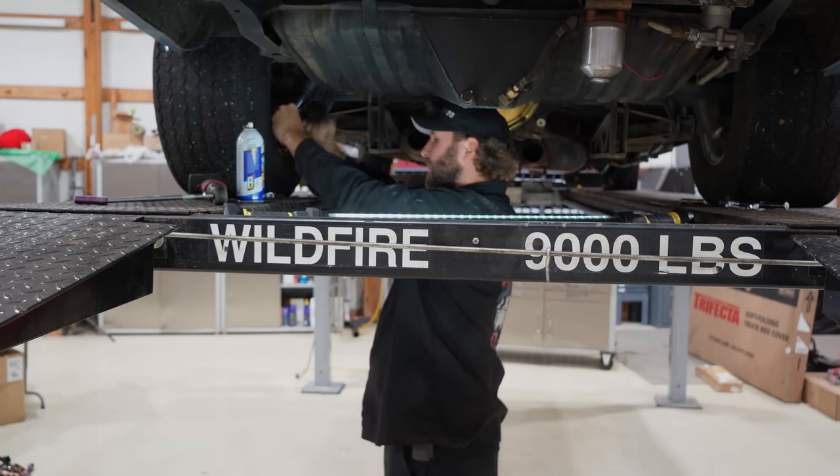Here we go again. 5,200 RPM-ish? That one's about 5,300. Yep, 230 horsepower, 294 foot-pounds. 230 horse, 294. It's pretty good. It's looking pretty flat on the graph. Were you full throttle, or three-quarter? Three-quarter. To get the best data, we need an on-off switch, ideally, or at least when you roll into it, then it's full. Okay.